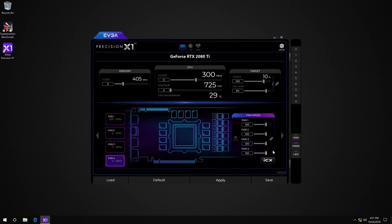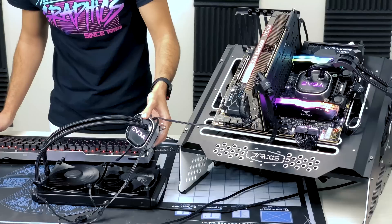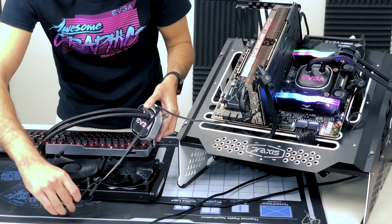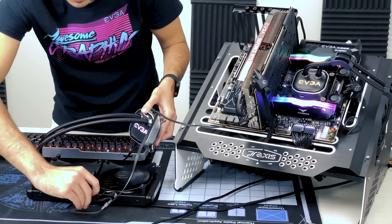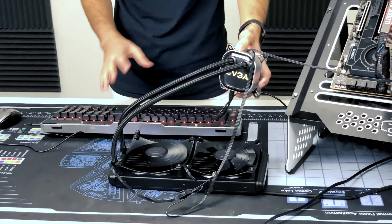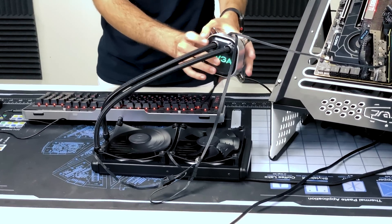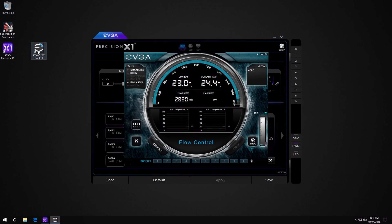This is technically Fan 4, so let's unlink these. I don't need these fans running at 100%, but you do need the CLC running at 100%. Only one of the two fans came on — that's a little odd. I think there's just something wrong with the connector on that one, not because of our configuration. The fans are intermittently working.